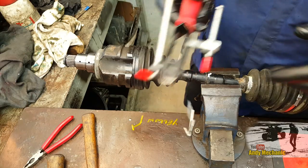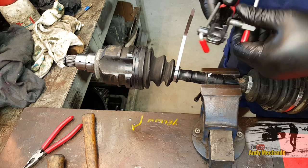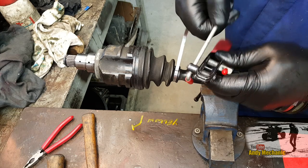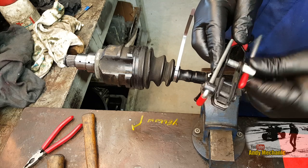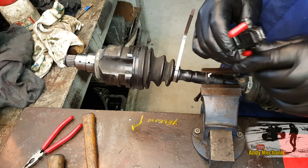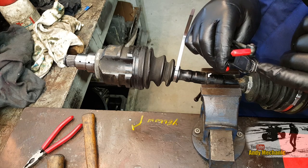And then you can get your tool, special tool number 36B. I'll show you how it works. It's got a little cutter at this end for cutting through the band. And at this end, it's got a really cool little winch drum thing with a slot in it. And of course, it's got a feeder at the front, another slot where the band first goes in.